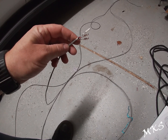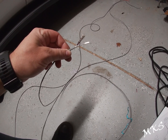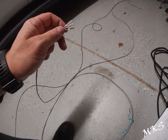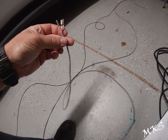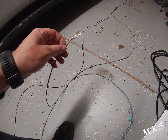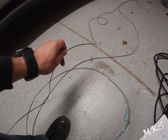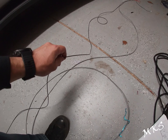And then this is, I want to say this is like fire alarm control wire or something, is what the guy told me, but I'll put the links in the description below. A lot of this wire you can get all over the internet, but it was super cheap, and we'll show you why you're going to want probably shielded and twisted pair wire rather than just running lines parallel to each other. It has a lot to do with interference, noise on the lines, so you really want to separate your camera and return signals.